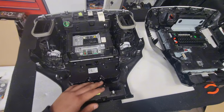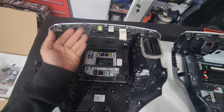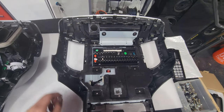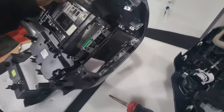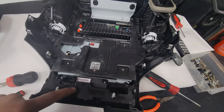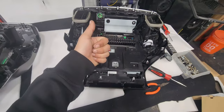Get a nice table so you can have the Tesla style and your original radio with its kit side by side, because you will have to transfer the air vents, the buttons, and the cigarette lighter. Each one of these things have their own screws and clips that you will have to transfer over as well. So you're going to be using everything as it's plug and play. You remove one side of the fan, put it onto the other with the same exact screws in the same exact holes. It's very simple.